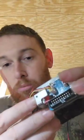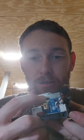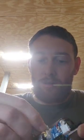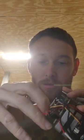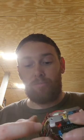Now we'll take the black wire with the red end, and we'll plug it back into that red kind of plug right below this metal bracket. And then we'll take the 2 thinner wires for the thermistor and plug them in right here on the edge of the board. Now, both of these are keyed so that you can only put them in one way, so there's no option to get it confused and you won't mess it up.